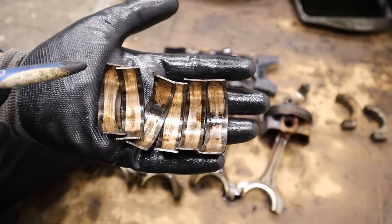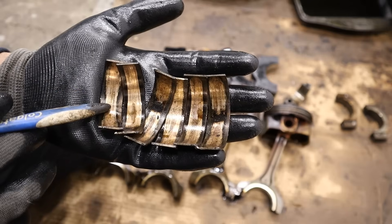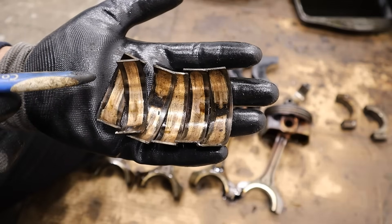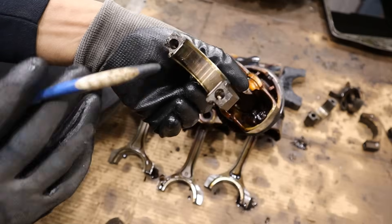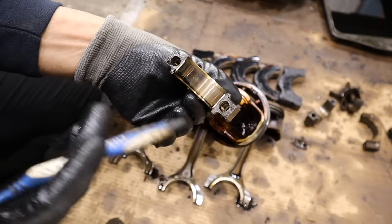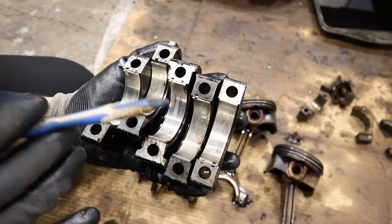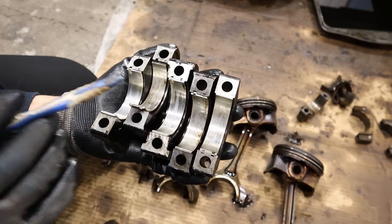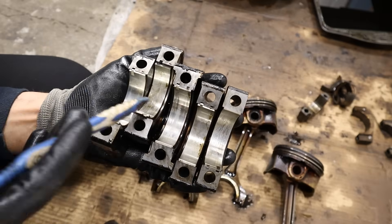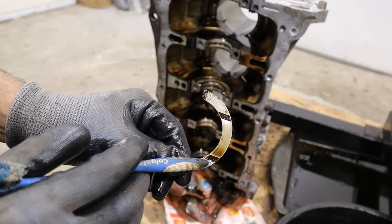As to why these engines fail so often — especially the connecting rods — it's because due to a manufacturing defect, debris was left inside the engine, and that debris over time clogs up oil passages and starves the bearings of oil, causing them to seize up. Could you just slap some bearings in and call it a day? Probably, but remember you've got all that debris floating around — it'll come back and eat the bearings again. Usually main bearings get oil first, and connecting rod bearings get damaged first because they're further away in the oil stream. To see these actually chewed up means this engine had a pretty bad lubrication failure. Even the thrust washer on the block is all scored up and damaged.